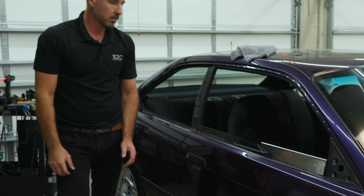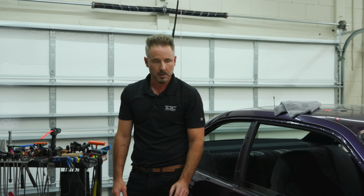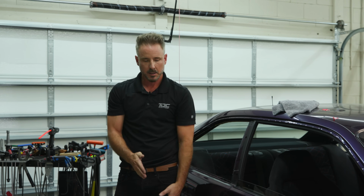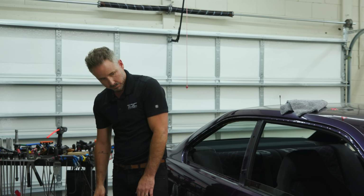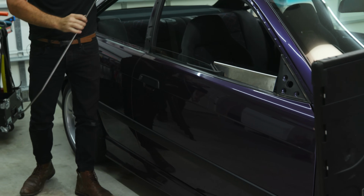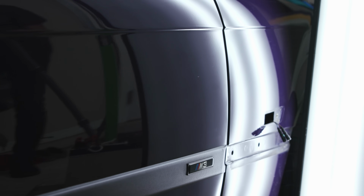Okay, so plenty of space to get down and in. I didn't even need that door panel to be off to know this, but here's the tube, here's the skin, right? I've got to get on the inside of the tube and then arc back into that metal for that little crease right there in the corner. This one doesn't want to make it at all. So as I'm working in there, I'm feeling around and knowing what it is that I need to do.